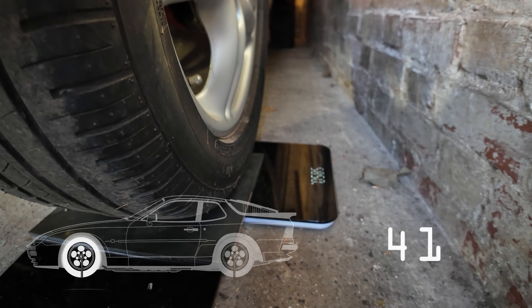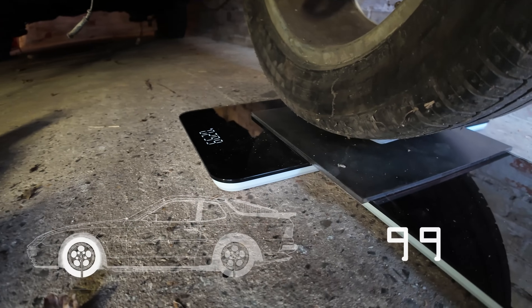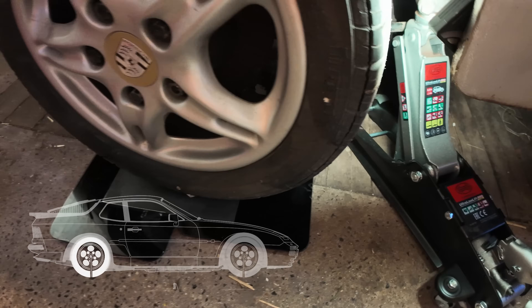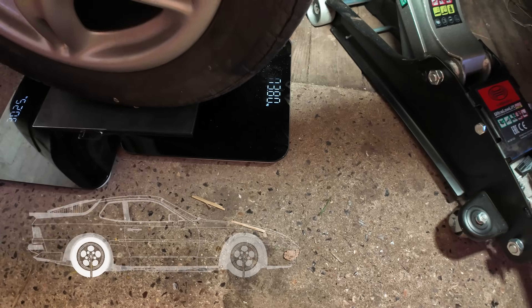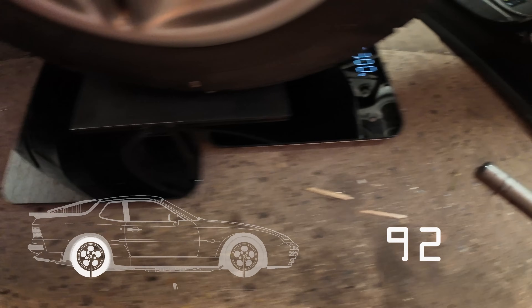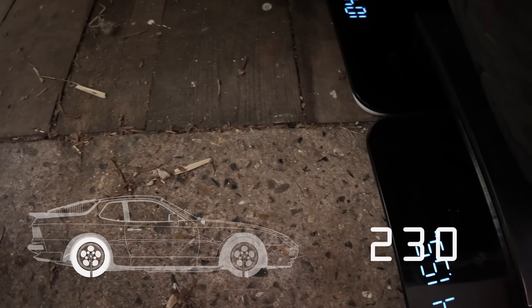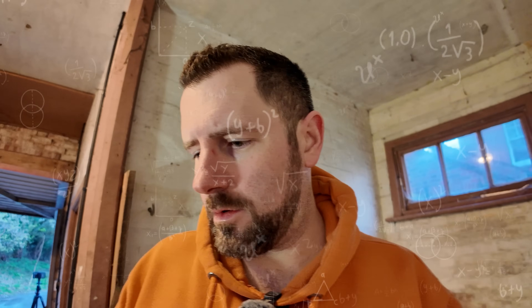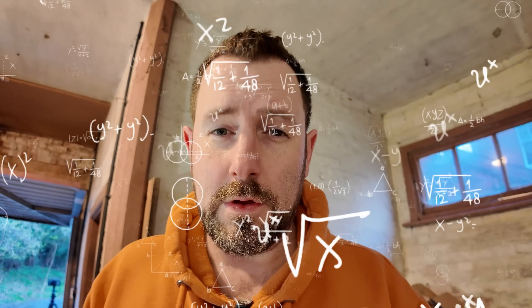Risky late-in-the-day move here — I've got to go home, I've got twins to look after. Because the other side was so light and these are each rated for 180 kg, I've put three under rather than four. Let's see what happens. So we've got 41, we've got 58, and over here we've got 72. Moment of truth — what have we got on the rear? So we've got 92.9, 41.55, and 104.3. So on the rear, we're looking at 240-ish.